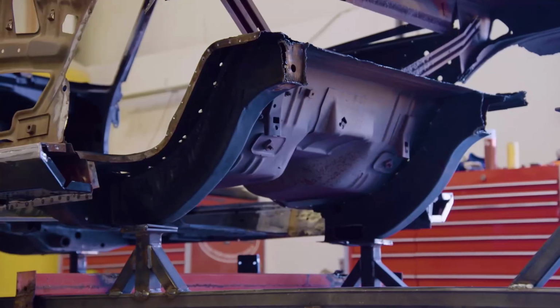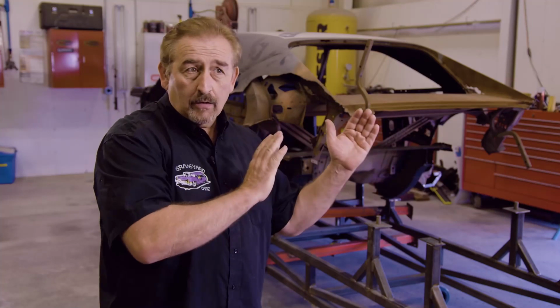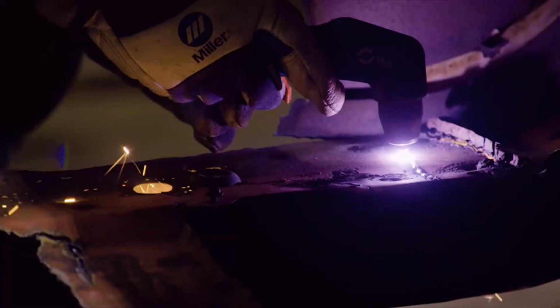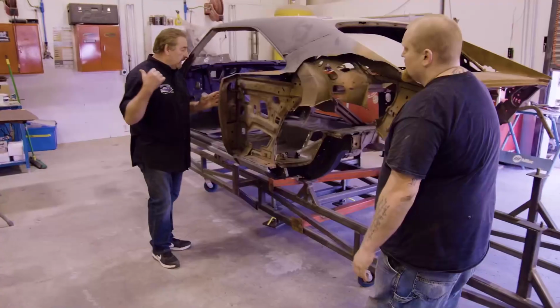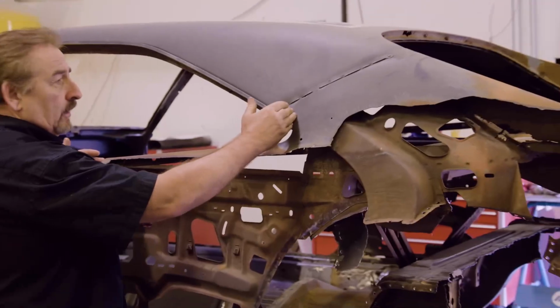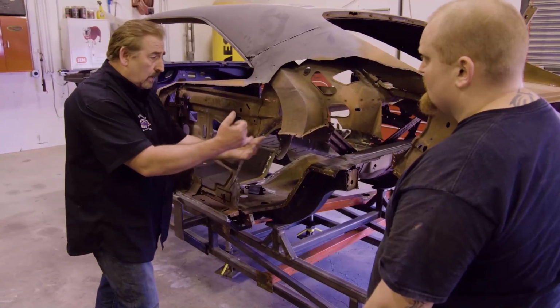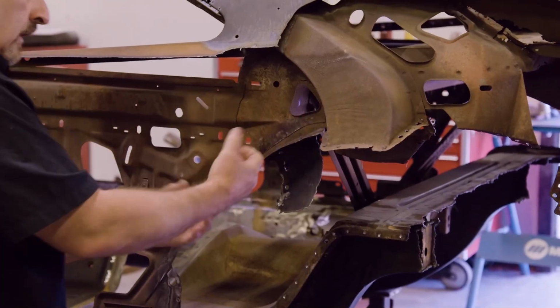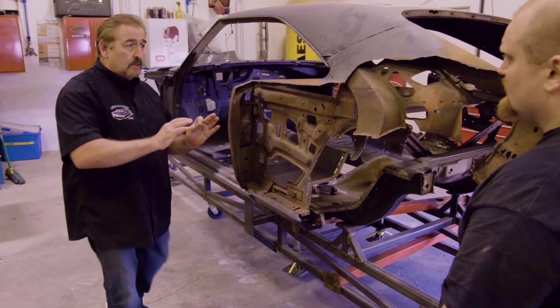Now, again, on this car, doing the big fly through the air and coming down, hitting that front corner the way it did, we've taken care of all the immediate damage, the initial damage that you could see visually with your eyes. You already know from the other ones you've done, we're going to do full quarters all the way up to here. All right. The remnants of the outer wheel houses, I want you to drill out all those spot welds through this quarter inner structure, just like we're getting ready to install the new pieces on it. I want you to go around, cut, trim, clean.